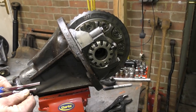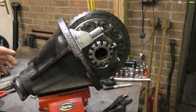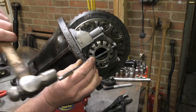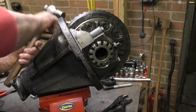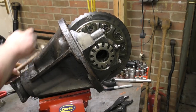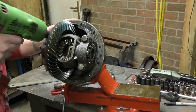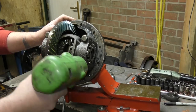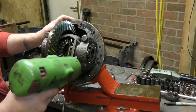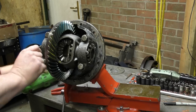It's best to do a few measurements before you strip, so when you put it back together you'll have a better idea where you're going. I have a 4mm punch — the roll pins, whether this type or the lever-over type, you knock them out or just knock them back on both sides. This allows the bearing adjustment caps to be undone. I'm loosening them off now but not removing them yet — I need to show you something first. LRT51018-5 is an adjuster tool.